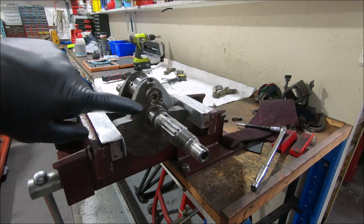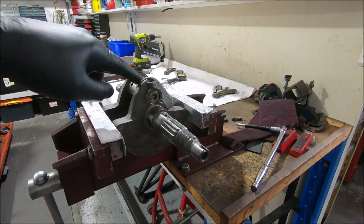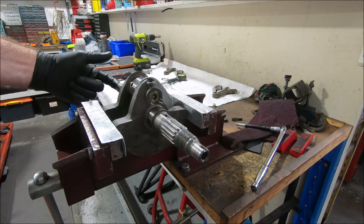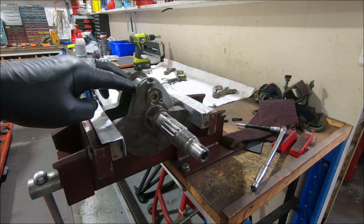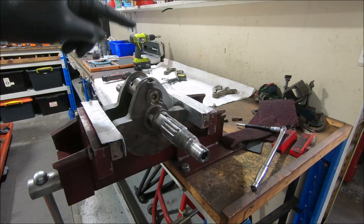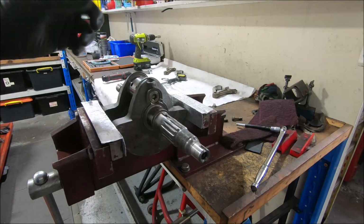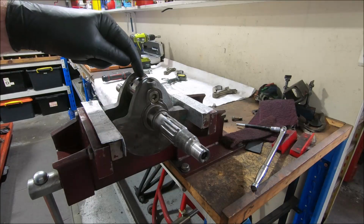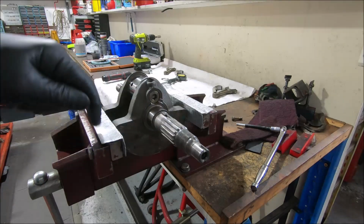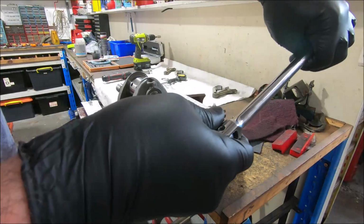This crank has a plug in the big end, so the big end hole is about that size internally and acts as a sludge trap. So when the oil comes into the crank, up through to fly out here to feed the rod bearings, this section here is like a dead oil section, if you like. Because the crank's spinning, any dirt in the oil tends to get centrifuged out and ends up resting against this part of the crank. Sometimes you pull these plugs out and you can scrape a whole lot of what looks like clay, which basically it is clay, out of the oil.